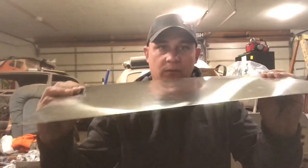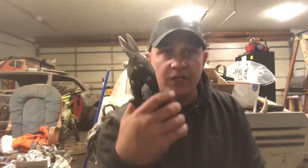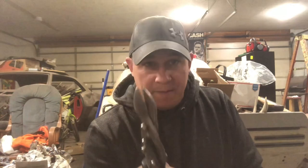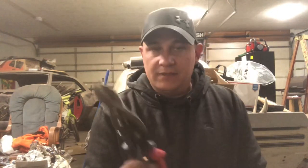When it comes to cutting metal for your top, I use 15 gauge aluminum — it's very forgiving and workable. Some people use tin snips. If you're using sheet metal like 16 gauge — which is what was used on automobiles back in the day — it's really thick and you can use tin snips, but every time you pinch it you're going to get a little pinch mark that you'll have to hammer down. I never use them, I hate them. I'll show you what I use instead.